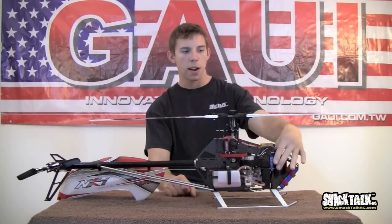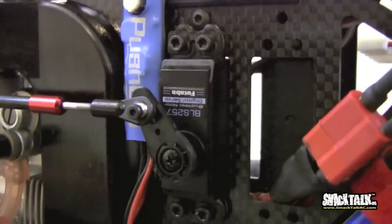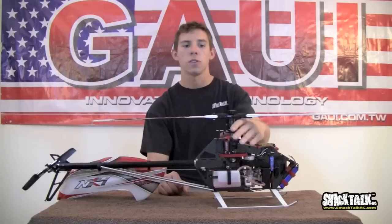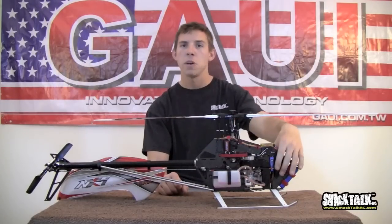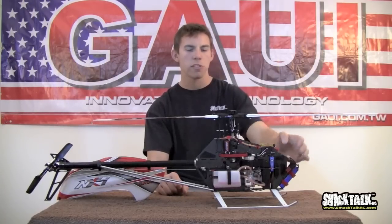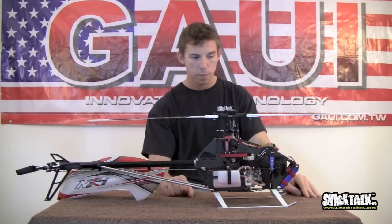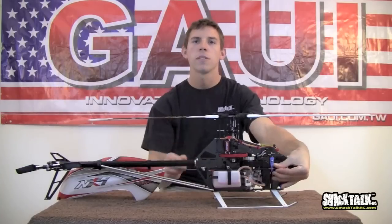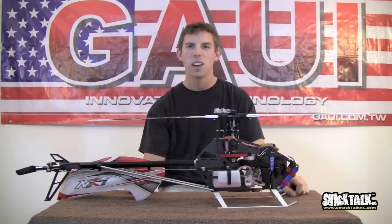Going forward, we've got our rudder servo and on this side our throttle servo. We're running mini servos on everything — just five mini servos drive the entire helicopter. I recommend three metal-geared servos up here with good torque and speed, and then mini servos for the throttle and rudder. For the rudder I'm using brushless 257s from Futaba. Rudder pushes the bell crank — nothing crazy, didn't want to reinvent the wheel. The bell crank also gets our rudder up and away from the smoke, oil, and all that stuff — keeps it a little cleaner.